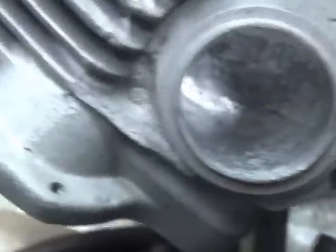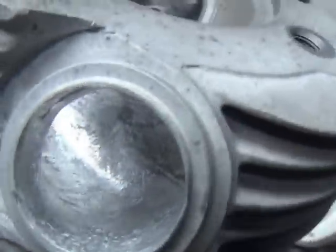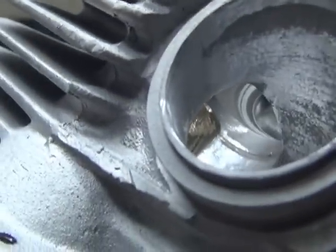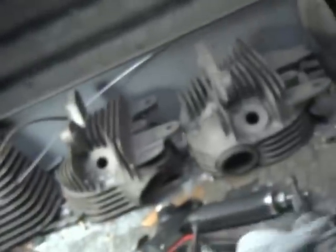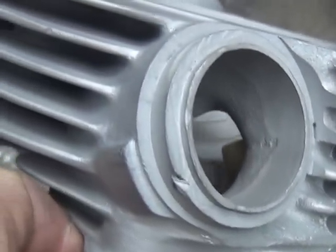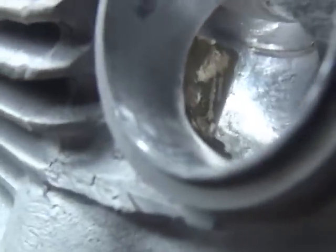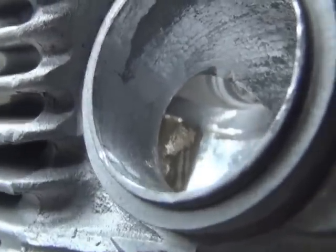And then over here on the inlet side, you can see how the air can go up around the corner, you can see the valve guide, then go out the top up there. You're still making a squiggly line through there, but compared to this squiggly line — you can just barely see the valve guide on that one. On this one here, you can come around and see just about the whole guide, and you can also see out the other side there.